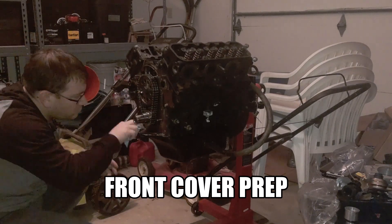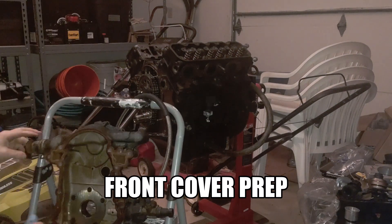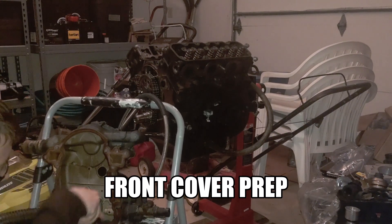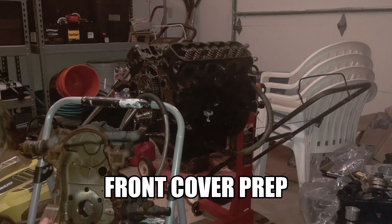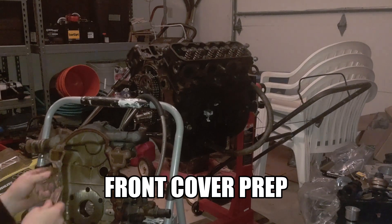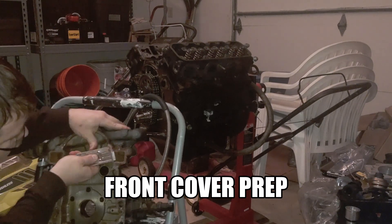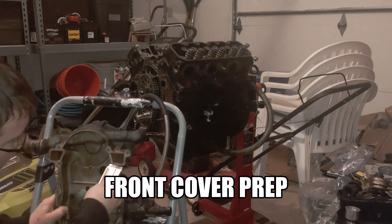This is when I cleaned up the block to bolt the front cover on. I took a lot of time prepping the area and making sure the gasket sealed well — this is a pretty important area since it's going to be hidden away internally with oil sloshing around and coolant passages to deal with. You then get to see me clean the original style paper gasket off the surface of the front cover. Since we've been running a double roller chain, we had a machined oil pump cover and ran double paper gaskets for clearance of that double chain. Everyone likes to show off the glamorous parts of builds, so I'll sprinkle some of the boring things in here and there.